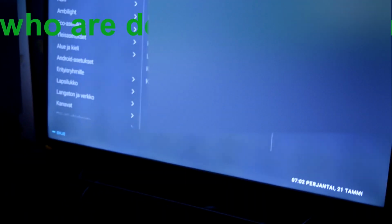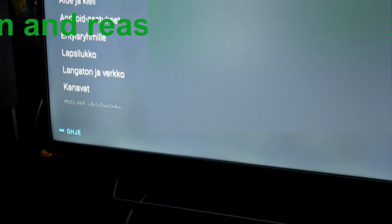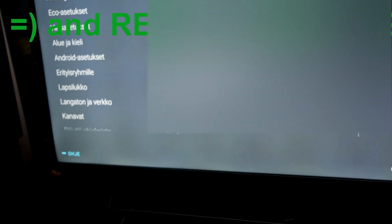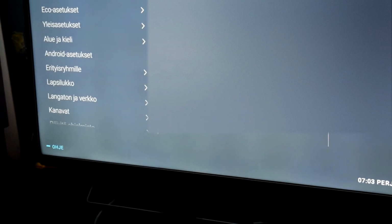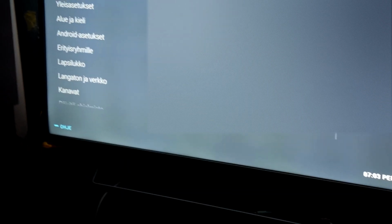I managed to get that annoying image away. What was right there? And I think overall it is now better. And it was indeed that little film between the backlighting and the LCD panel that was not in its place.